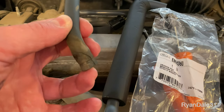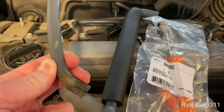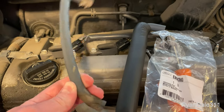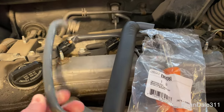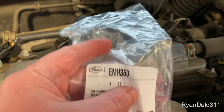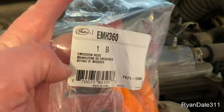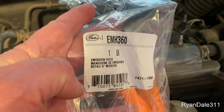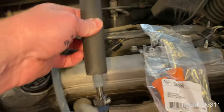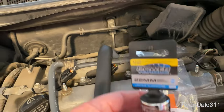When I went to pull off my PCV valve this hose split, so if you've never done this before there's a pretty good chance your hose is gonna be hard and brittle and it'll probably crack, so you might want to go ahead and order one of these hoses. I got this one from O'Reilly's — it looks like it's a Gates, that's the part number there. I also got a 22 millimeter deep socket to go on the valve itself.